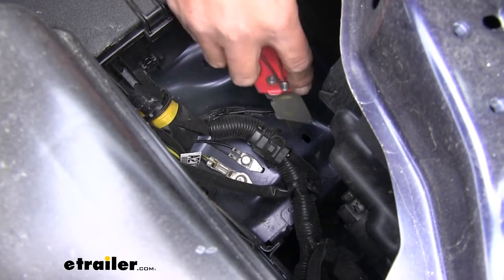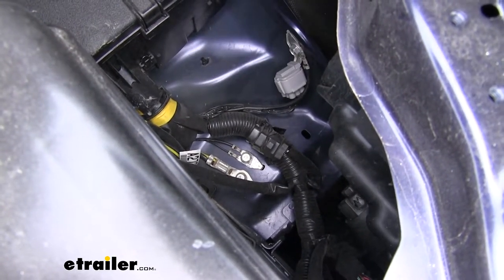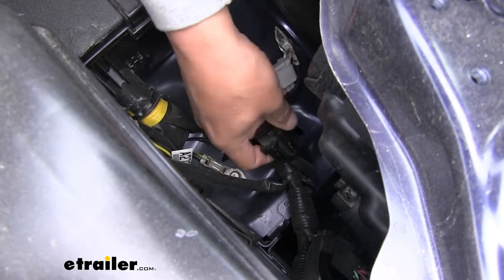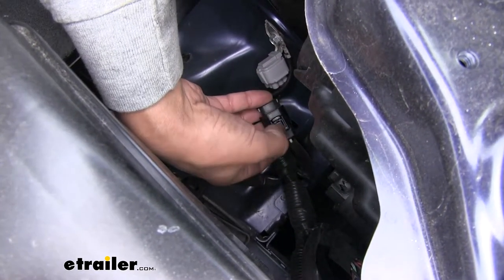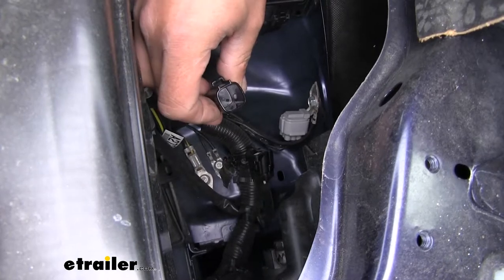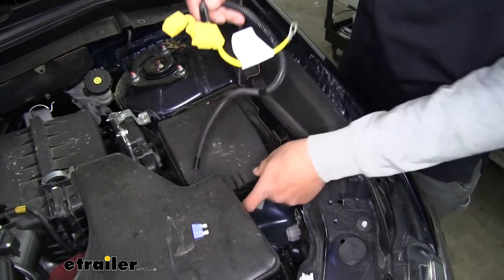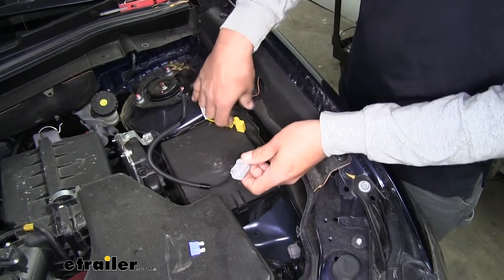So again I'm going to get a knife, cut the tape, being careful not to damage anything else — which will free up our wire. Now there is going to be a plug, just a dummy plug, plugged into that harness. You want to push in on that square section and pull that plug out. I'm going to remove the cap, and we can take our new harness — make sure we pull our fuse out first and set it aside for now. We'll find the gray plug, which is going to match up to that plug underneath, and we'll plug it in making sure it locks in place.